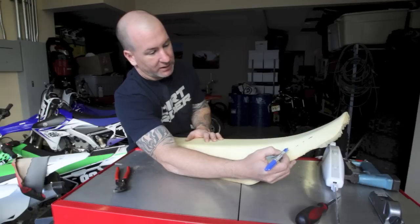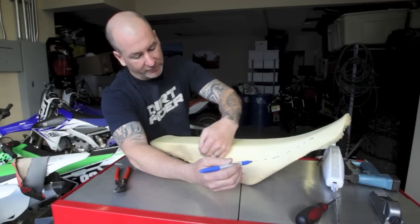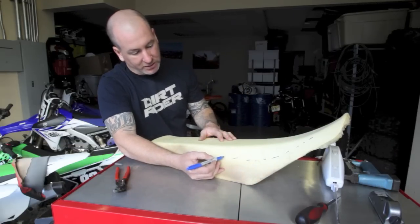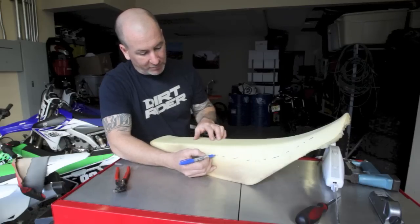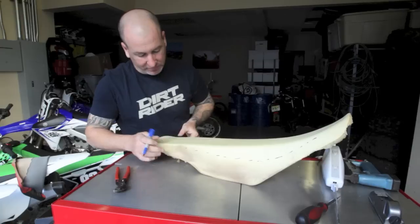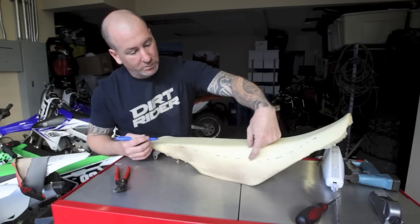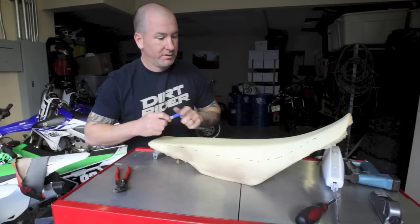I make a rough dotted line and try to follow the contour a bit. You're going to have to take some out of the middle — it might create a little pocket. But if you're short, touching the ground is a lot nicer than having a complete straight line to the gas tank. I try to do this equally on both sides so I have an equal cutout on the foam. Just try to ease it up back towards the back because it's thin under the seat base. In the end your seat might not look as factory-smooth, but you can gain almost up to two inches of clearance.